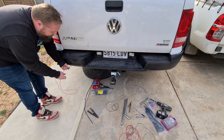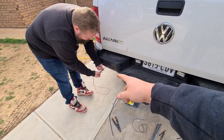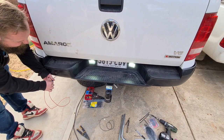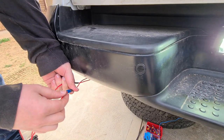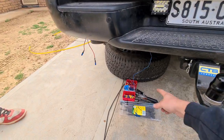We've done everything to make the lights work. Luke's got the two switch wires which we haven't terminated yet, and he's got a piece of wire acting as the switch - when he joins it together the lights come on and off, and you can actually hear the relay click. Now we just need to get a switch for here and wire up the reverse light.